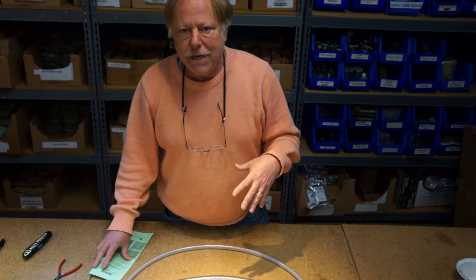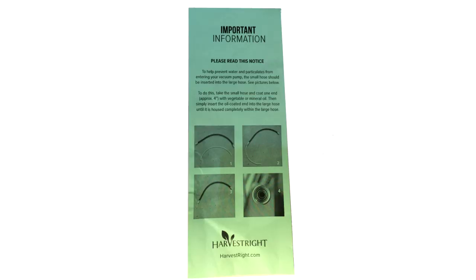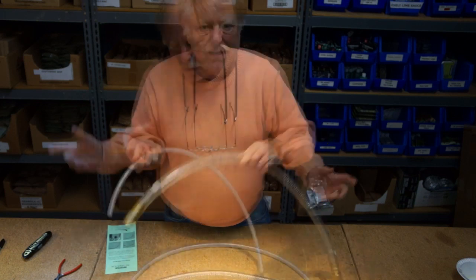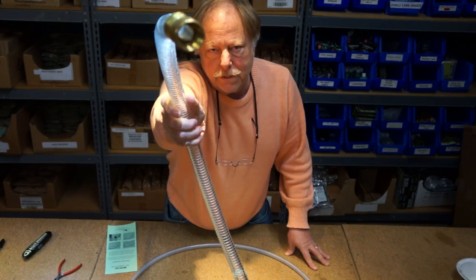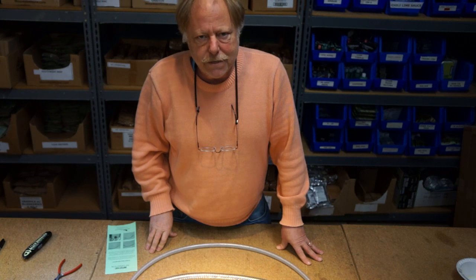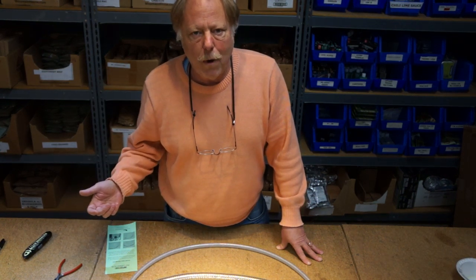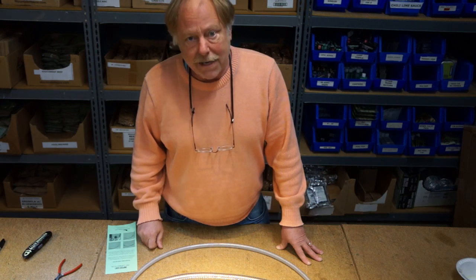If you've purchased a freeze-dryer or a pump recently, they're sending it out with a little kit — a piece of tubing and an instruction sheet. What they want you to do is insert it into your existing vacuum hose. They've discovered that if this opening in the brass fitting is a little bit smaller, they're able to reduce the amount of water vapor that gets into your pump and turns back into water. They've also found that it reduces the amount of particulates that get into the oil, so it keeps the water out of your pump and keeps it cleaner. I'm told it reduces water and particulates by four-fifths — 80% — so that's a huge savings and they'd like everybody to do this eventually.